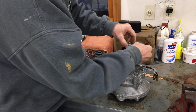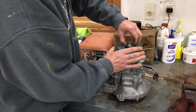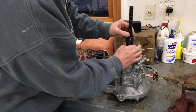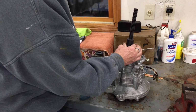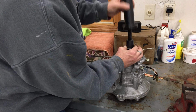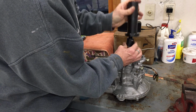So let's install those pieces. So that's going to slip under there. That's going to slip under there. So if you got a real tight piece, you got to have this adapter up above your plates. So screw the adapter into the puller, and again, grease that up. Your puller is going to go on, and there is a little pin right here that aligns with almost like a keyway in the puller collar.